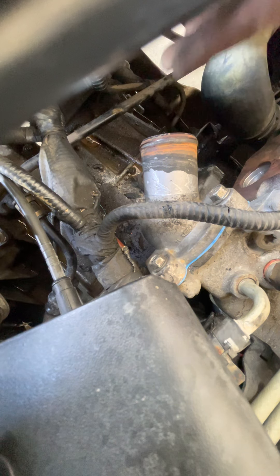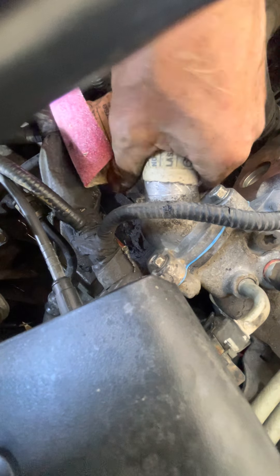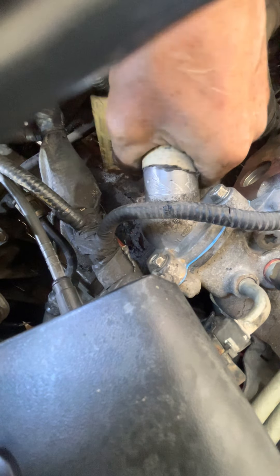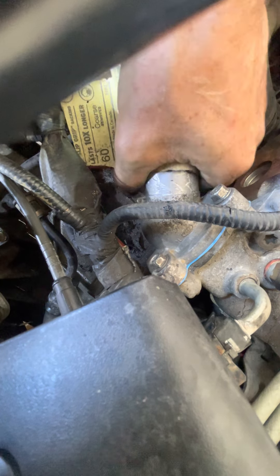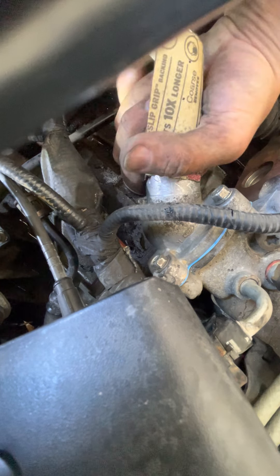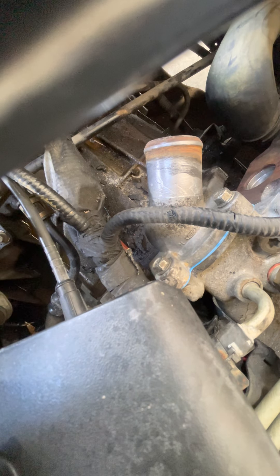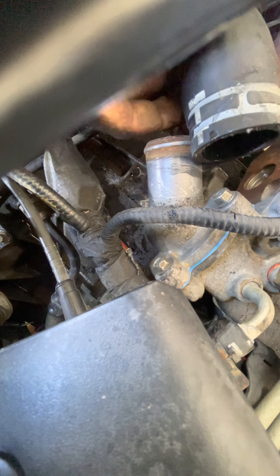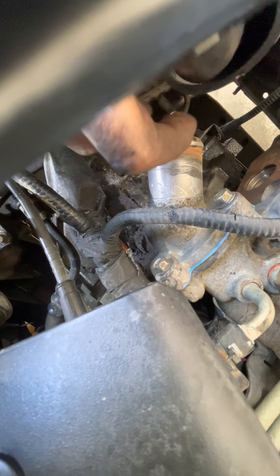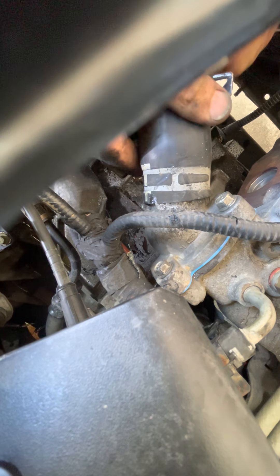You have this hose — and clearly that's corroded. I'm going to take some sandpaper and get rid of some of that rust. You see the rust — that's the stuff that gets in your heater core and the radiator and plugs up the tubing. That causes your heater core in the cabin compartment to not work properly, and you don't get any heat coming off your fan because the heater core is all plugged up with rust.